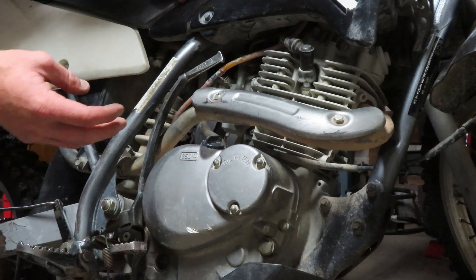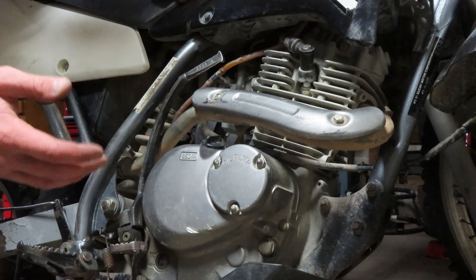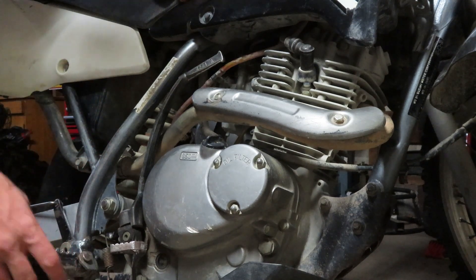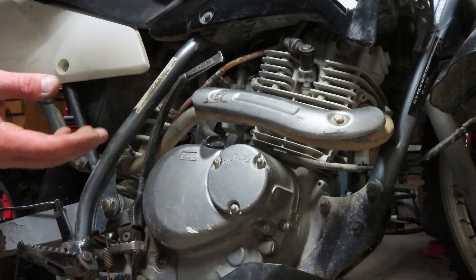Spark plug wise, we're looking for a bright blue spark that goes pretty much straight. When it starts straying off track, it normally means there's too much carbon build up on your spark plug. This is normally a case of replacing it.